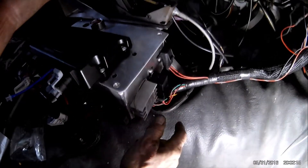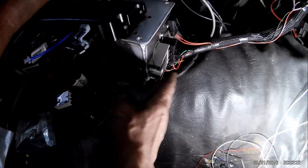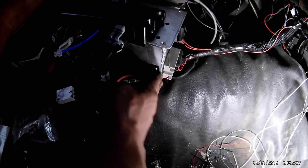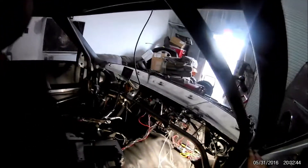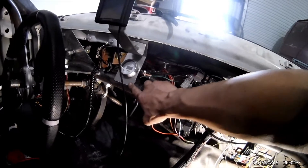I was going to put all the relays in the box but decided not to so they're easier to work on. I've got to finish screwing it down, but it's got my start button, my power button, I mounted the ECU right on top, and on the front I mounted the power fuse. The Terminator X comes with a relay built in for the fuel pump, so I mounted that there. I also have a solid-state relay for my trans brake mounted on the side. This is the main power cable going back to the battery with the fuse — everything's mounted good, wiring routed over the hump and cleaned up.